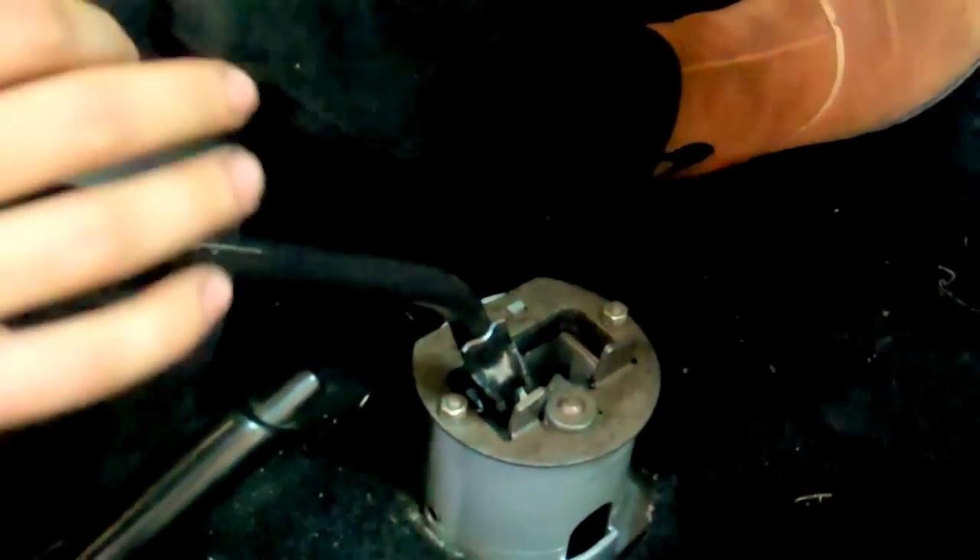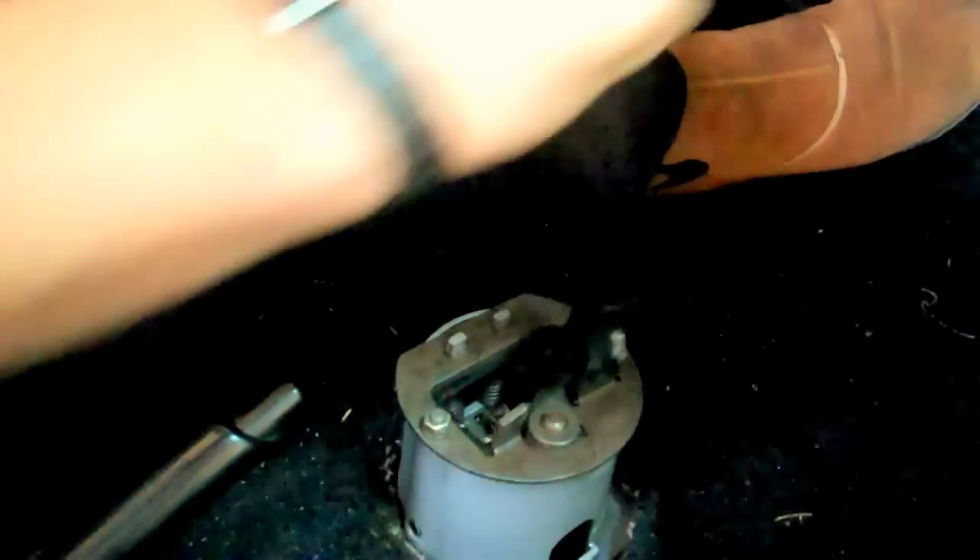So then I'm going to go back here and gently tighten that sucker up. Now that it's fairly tight — I'm going to tighten it more later — but I just want to check and see. Oh, that's smooth, that's nice. It goes into everything real nice. I want to tighten it back up, and you want to get it real tight because if you don't and you're shifting all day and then all of a sudden you lose it because the shift coupler wasn't tight enough, that would be not good. So now, as you can see, it shifts really smooth.